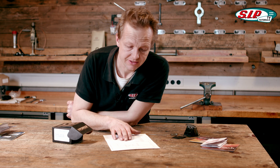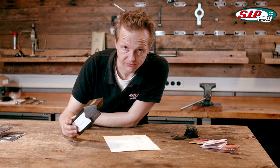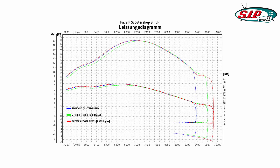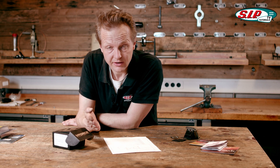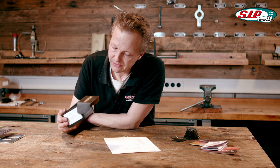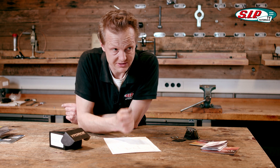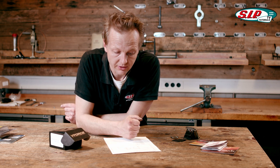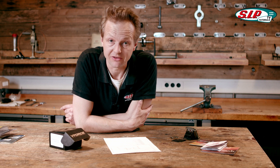The actual difference is the engine speed at which the power peak appears. With the V-Force type of reed valve, the power peak is around 7,300 RPM. With the standard and Boysen reeds, the power peak is about 6,900 RPM. So if you had an exhaust and cylinder that supports a power peak of 7,500 RPM, then the V-Force would be the most powerful option. Since this cylinder and exhaust want to make power at around 7,000 RPM, the other types of reeds are the better choice in this comparison.